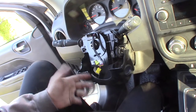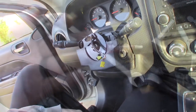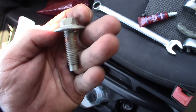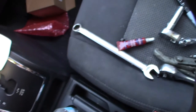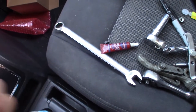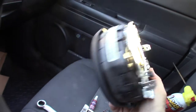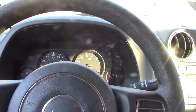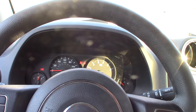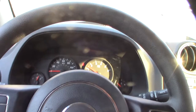I've got it back on — now putting the bolt back on. Make sure you use a little loctite because there was loctite on there originally, but don't use the red loctite because you'll never get it off without heat — use blue instead. The airbag colors just go yellow and black. It always makes me a little nervous, like a bomb in your hand. The airbag is right there and it didn't blow up in my face.